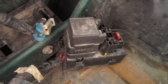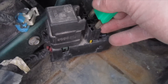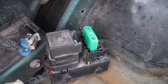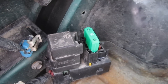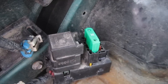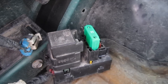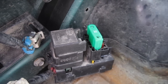I'm going to go ahead and replace the fuse, but the thing to keep in mind is something caused this fuse to blow. There is a known issue with these vehicles with this particular secondary air injection pump — apparently there's a check valve that can rust open, and the pump heats up and moisture condenses on the inside of the pump, which can actually toast the pump. So a blown fuse is an indication that the pump is actually bad. I believe it's going to cost me in the area of $150 to $175 to fix. So I'm going to try this fuse, drive it around for a week, and if I don't throw a code, I'll just call it good. But chances are the pump is gone and I'll have to make another video on how to replace that system.